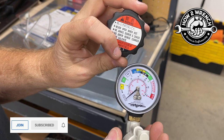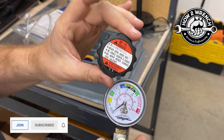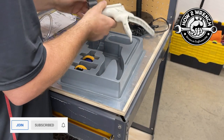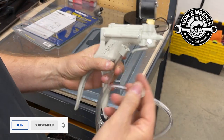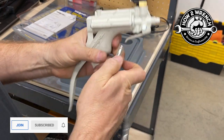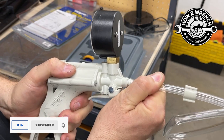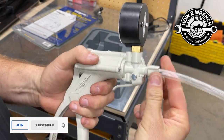This is the threshold though: if we have a 1.1 bar cap and it's only holding 13 PSI, that means the cap's bad — it doesn't hold enough pressure in the system. And if you see that, you're typically going to see a leak in the system as well. What this kit has — I just disassembled it for storage purposes — is it comes with a hose. You want to slide your supplied nut on there first and go up around the nipple here.